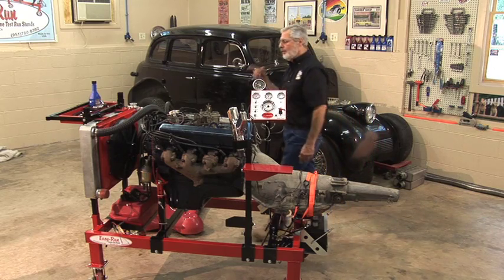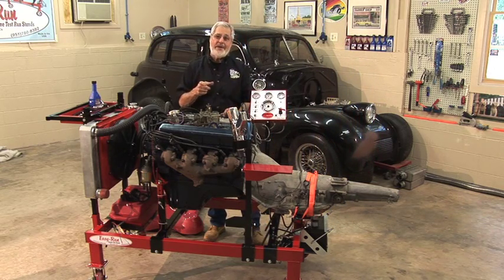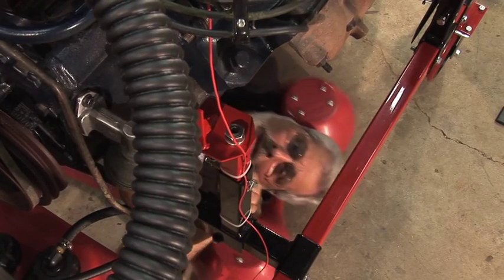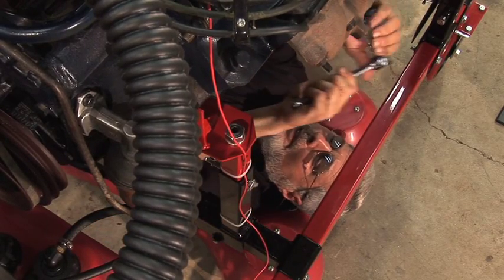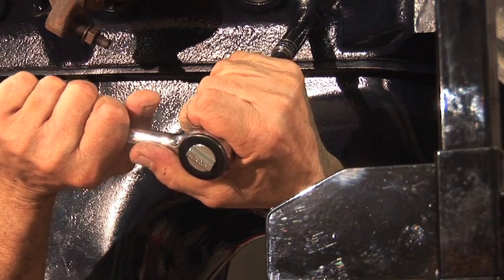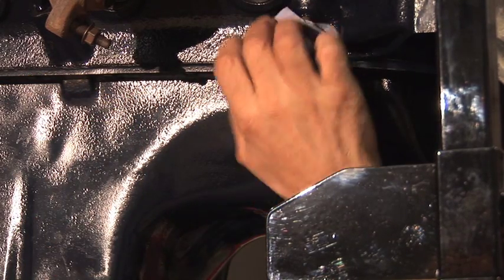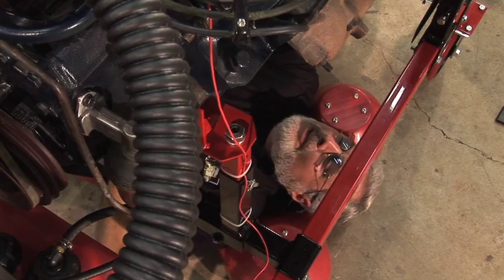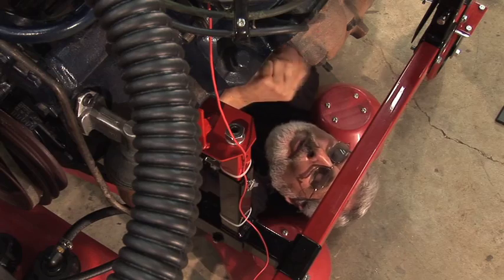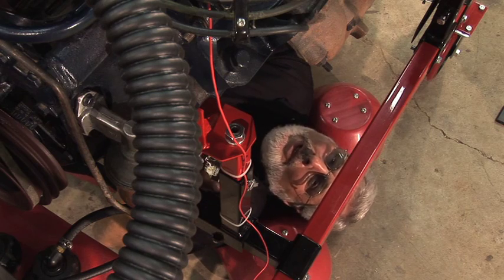Now, when I put the coolant in, I found something going on. We're going to fix the leak. This is the neat part. Found the left side block drain leaking a little bit. It's just a pipe plug. Tighten it up a little bit, make sure it's nice and dry. Easy to get to now, but once the downpipe's on and covers it, or the exhaust pipe, it's really tough in the car. So that's the beauty of finding things wrong.